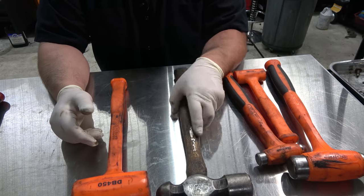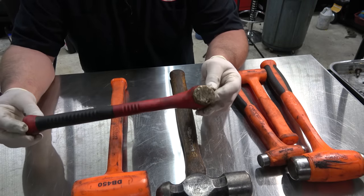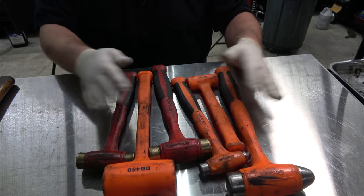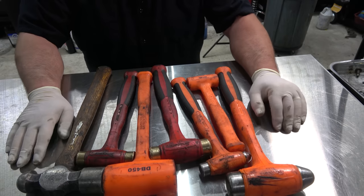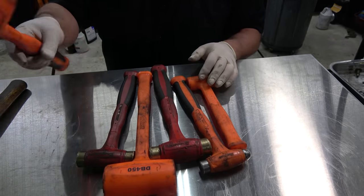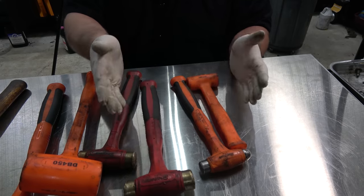The only issue I've ever had with hammers is when I've missed and tore up the handle. I'd recommend some sort of brass in the 24 to 32 ounce range. Basically you can get away with three hammers — that's literally all the hammers I own on my roll cart. You don't need a huge selection. You just need a good whacker — a Thor, a Mjolnir, one big sucker — a dead blow, and a brass hammer. That's all you need. I hope this video was helpful, and as always, thanks for watching. I am the Flat Rate Master.